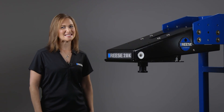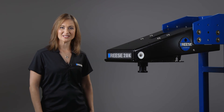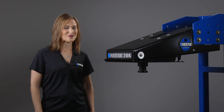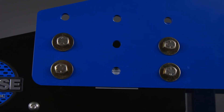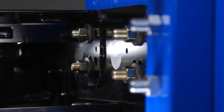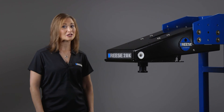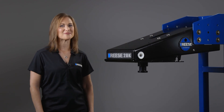Installing the 5th Airborne is quick and easy too. Simply remove the current pin box on the 5th wheel trailer. With a second set of hands to help, raise the 5th Airborne into the trailer's wing set, then insert the provided hardware and torque to specification. This new 5th Airborne fits standard hole patterns including the Turning Point hole pattern and Rhino pattern.